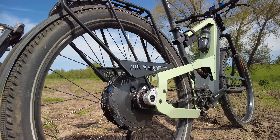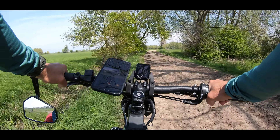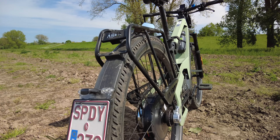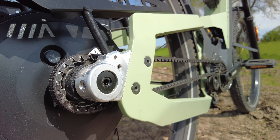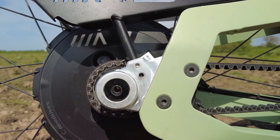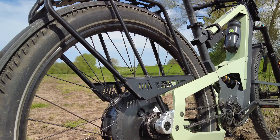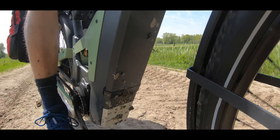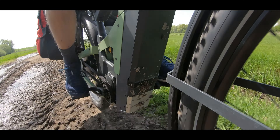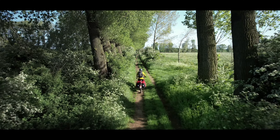Turning to the back of the bike — same rim and same tire. Above that tire is the rear fender and the rear carrier. After riding a dirt road, I suddenly heard a rubbing noise. When I stopped, I noticed that the rear carrier together with the fender were bent over to the left side. The main reason appeared to be that I lost a bolt that connects one of the feet of the rear carrier to the big aluminium part that connects the axle to the subframe. I also noticed that the fender and the rear tire don't have much space between them — so when riding on a dirt road, that space gets clogged up with dirt quite soon, giving an awful lot of noise on an otherwise very quiet bike. That is something Aska needs to improve.